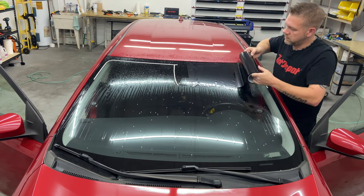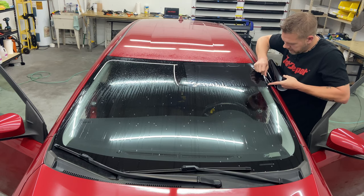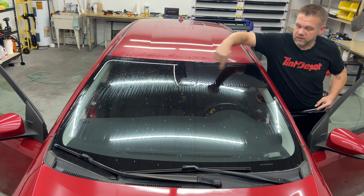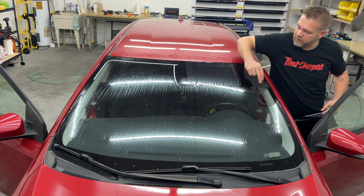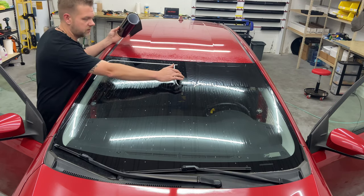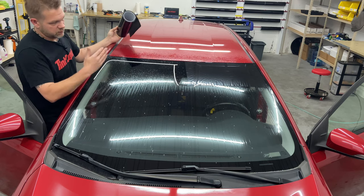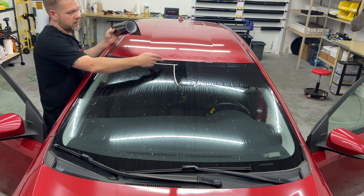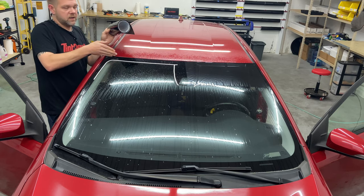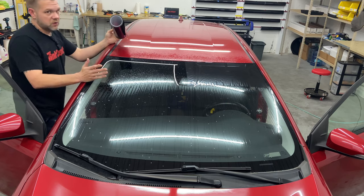I could do one continuous piece all the way across, but I'm gonna do two pieces because I like to adjust it. With the middle being cut out, I can actually adjust it a little bit straighter than your standard curved-style sun strip. With the middle not there, I can bring this corner up just a little bit for a straighter look along the roof line. When doing a solid strip without the middle cut, because of the factory edge and the curved window, you end up with a slight curve on the sun strip. To get it to concave the other way to match the roof line, you plot or cut it, or use the roof line as your guide for cutting if it's a clean line — then slide it down and freehand the sides.